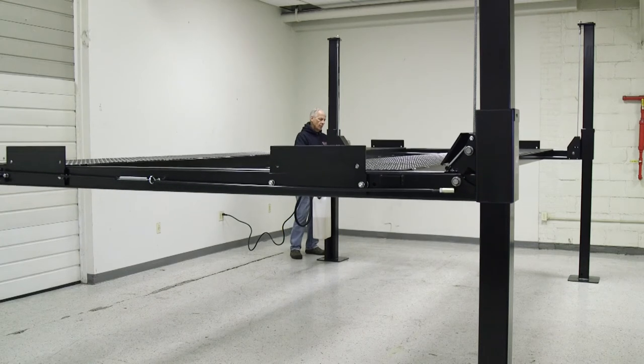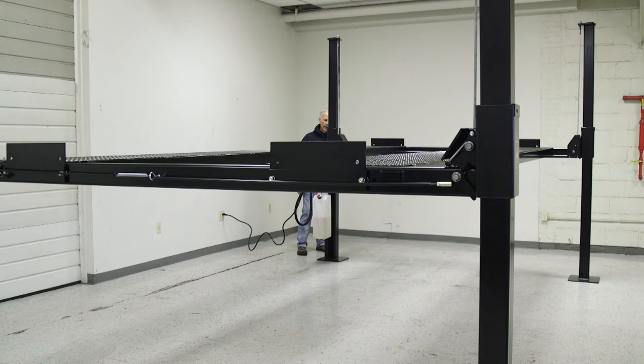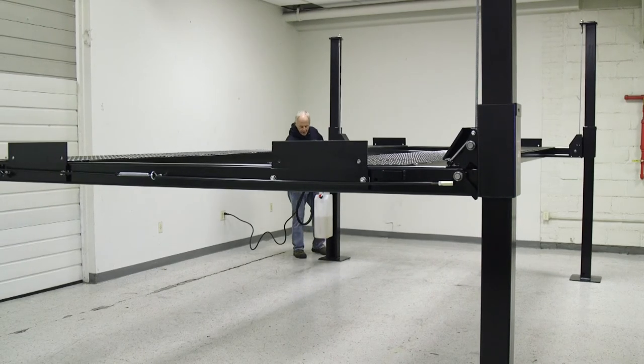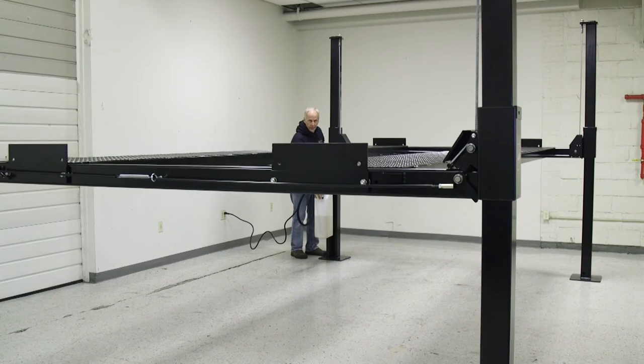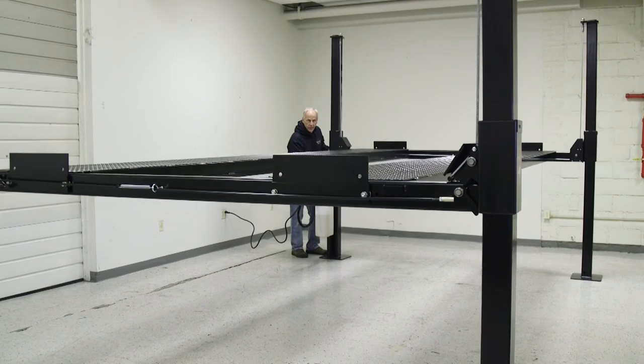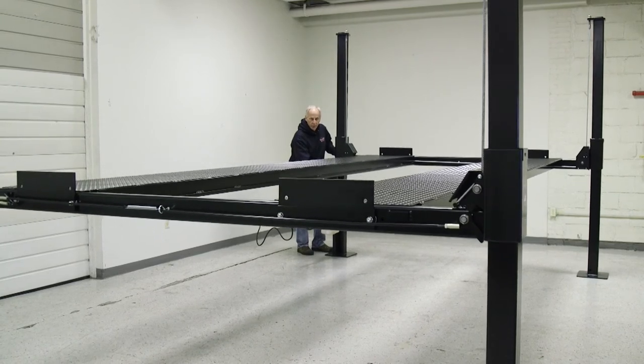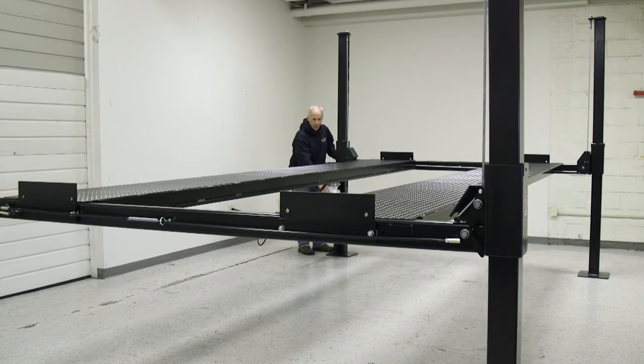Once we've come up enough, now I can disengage my locks. You'll see on that end that the locks are coming completely open on all four. I want to be able to see the tips of the locks so I know that all four are disengaged. And now I'm ready to lower the lift. This is going to take it down to where I can get the air out of the system. The very first time coming down, you're bleeding the system — you shouldn't have to worry about it anymore.